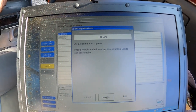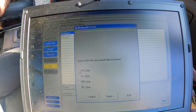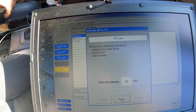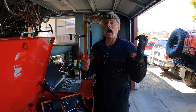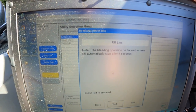We're doing this procedure another nine times for the front wheels — showing it one more time: click next, select front right again, click next, click next, Tan holds the brake pedal, click next and it operates. Pedal went to the floor, timer stopped, release the pedal, click next, wait 20 seconds. We have the front brakes bled using TechStream. For the rear brakes, we again need the engine running because it's a VSC vehicle, but Tan doesn't have to press the brake pedal — he just operates the TechStream program for me while I'm under the rig. For the rear, the steps are: open the bleeder plug, click next to start the 4-second timer, fluid flows, then close the bleeder — do not press the brake pedal for the rear.